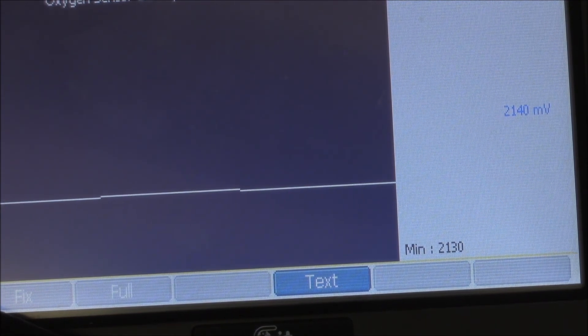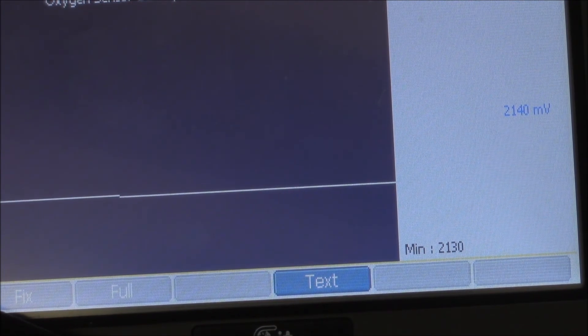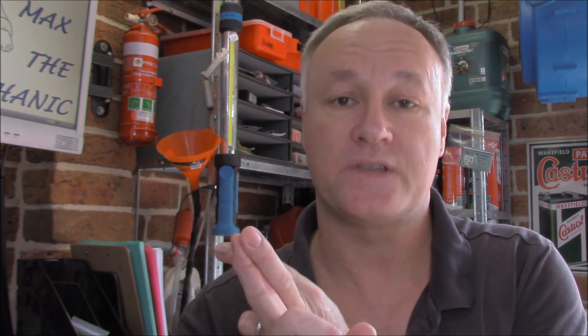So although this is a very quick and dirty test, we can clearly see that it shows we have integrity — wiring integrity from our ECU through to our sensor — and of course that the ECU is responding in kind. I hope that's been of some use to you guys. It works not just with O2 sensors, but quite a range of sensors that are looking for some sort of change back to the ECU. So I hope that quick method will be helpful for any future diagnosis to do with sensor integrity, ECU integrity, and wiring integrity.